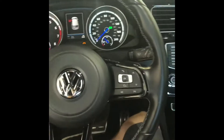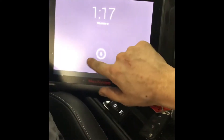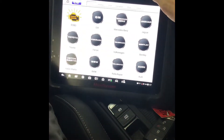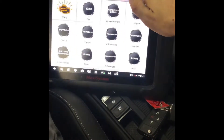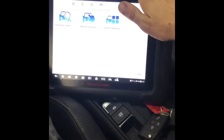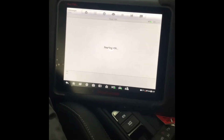To reset the light on this Volkswagen, you've got to turn the key on and plug into the OBD port. I'm using the Autel Maxisys system, so that'll actually be an automatic function for me. We'll go into diagnostics, select Volkswagen, then standalone, because we're not doing a full scan — we're just doing a reset.